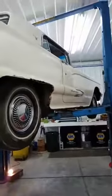We're not going to be using anything mechanical back here again, but we'll take a look. Structurally it's safe enough to drive — the leaf spring perches and everything are okay, the leaf springs are sprung but nothing's going to fall off; it's just rusty. Back by the gas tank you've got the inner quarters — the trunk extensions — those will all have to be done. It's supposed to be out to about here, and that's a lot of rust. This side is worse. We're going to do the trunk extensions, probably some trunk floor repair, definitely the quarters coming all the way to the back and all the way to the front, and then we'll do the rockers. The doors need a little bit of repair as well.